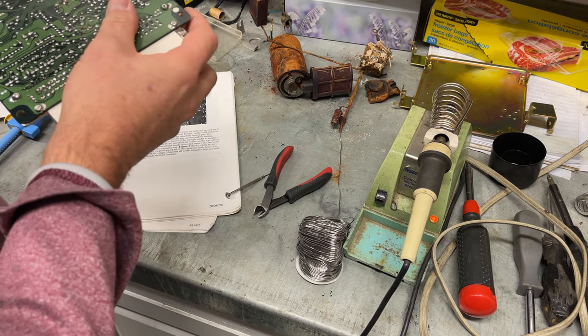I'm going to do a data log — collect data, click select. This is just some of the things you can check. There's a lot of learning happening right now as all the fuel trims have been reset to ground zero. The good news is it's running on its own ECU and it is fixed. Looking at the O2 volts — that's the blue line — it's starting to oscillate up and down, which is exactly what you want to see. If it's not oscillating, the O2 sensor isn't working, but this looks great.